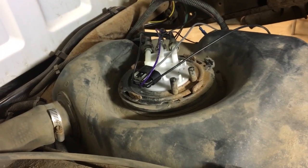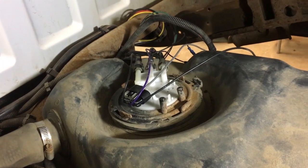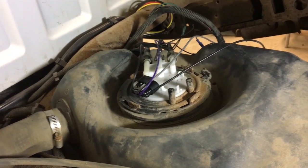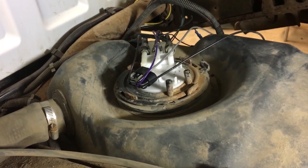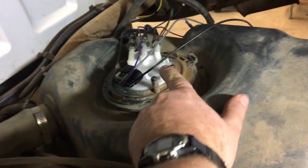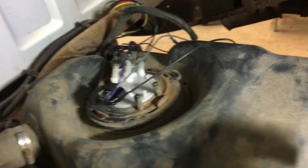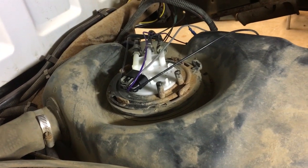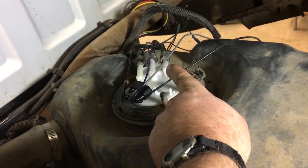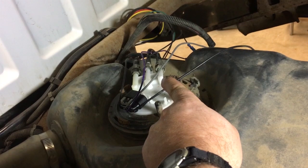Alright guys, so we're looking at the top of the fuel pump hanger in my gas tank. I've got the bed tilted up like I did in the video a couple weeks ago — showed you guys the bed tilt method to access your fuel pump. And like I said, my theory is that in this bucket, that return line right there I think has a restriction on it. So what I'm gonna do is disconnect the return line right there and then we'll go over to the table and I'll show you how I'm gonna test this theory.